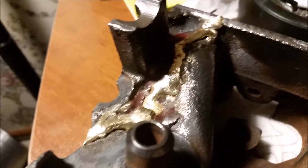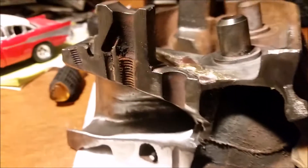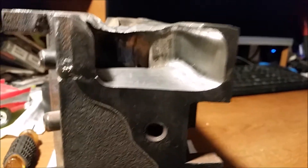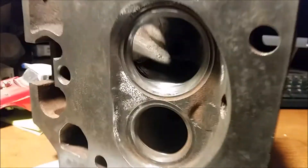As you can see, we're inside now. It's a new day and the brazing was successful. It's not the prettiest work, but it held — it's holding fine. So now I know I can braze, I just need a lot of practice getting better at it. Made kind of a cutaway of this head so you can see how everything works. Started doing some port work on it — just playing around with porting the intake out. What am I going to hurt if I break through? It's never getting used again. You can see where there's still part of the crack there — didn't get a perfect fill, but it's holding. You can see the crack up inside still, but not a huge deal.